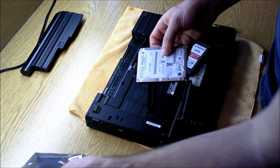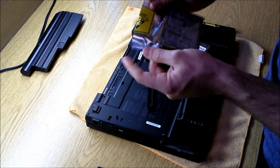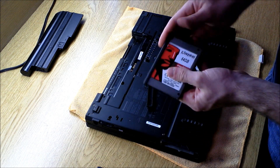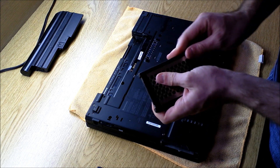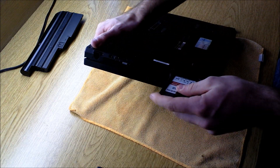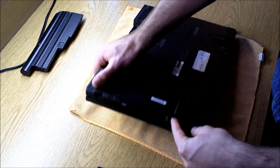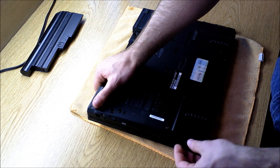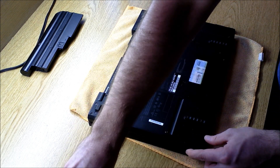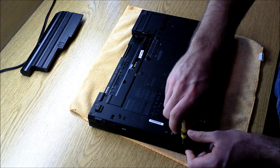Put your hard drive back in the anti-static bag that your solid state drive came in. Wrap the rails back around just like this, and then you can look inside and make sure you know which way the SSD should go back in. Push it in, then reapply this brace here and screw it back in — and that's all there is to it. Just a couple of minutes and you've got a solid state drive. Take care, I'll see you next time.